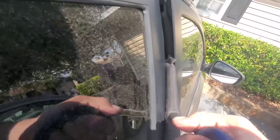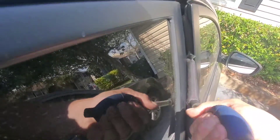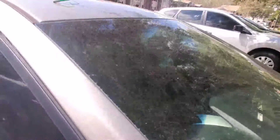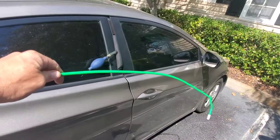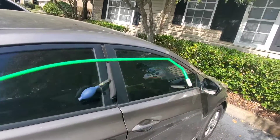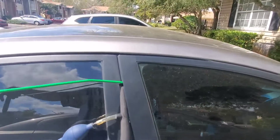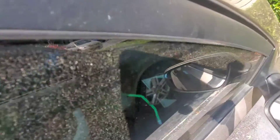We're just going to pump up the door. This airbag is starting to go out on me — it's starting to leak — but just pump it up enough to get your tool in there. Then we're going to reach inside to that door handle and flip that little flipper lock backwards. If you don't have one of these green reach tools, Home Depot sells metal rods and you can put electrical tape at the end — that will work as well. But if you're a professional tech learning how to do this, these are the professional tools. Just go in there, find your door handle, and flip it backwards.